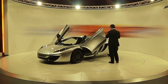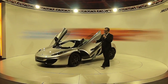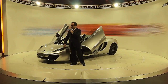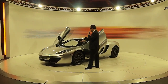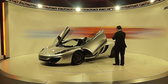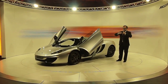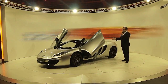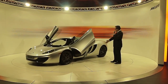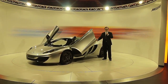Moving back — as I said earlier, the body shell is all about control of airflow. We couldn't put radiators at the front as other people do, because that's bad: you have weight that confronts the front wheels, which is very bad for handling, and then you have extra weight in piping. We have two very small radiators for the turbo heat exchangers, but the main radiators are back here. If you want radiators to face into the airflow for maximum cooling, that would make the car too wide. So we use the aerodynamicists from Formula 1 and one of the most sophisticated wind tunnels in the world at Woking, to create turning vanes that move the air straight into the radiators, which are close to the engine, thus cutting down on weight.